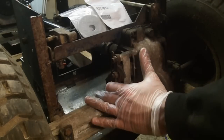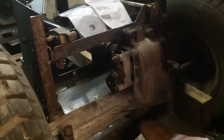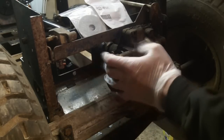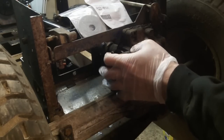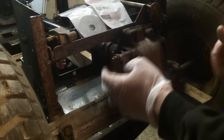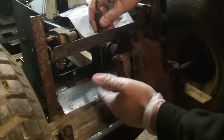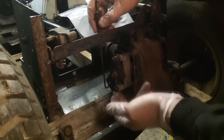Here's our transmission as it sits in the tractor. It's been flipped up on the side for the Power Wheel build. Normally it would be sitting with this side facing down towards the ground, and the brake assembly that you're after would be facing towards the right-hand side if you're sitting in the tractor. You're going to need to disengage the spring, which goes down through this and connects onto the arm that's on the back, and actuates this lever.